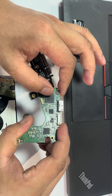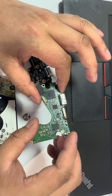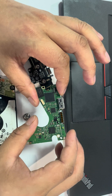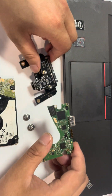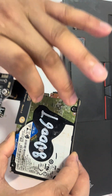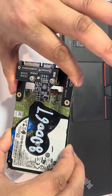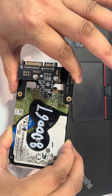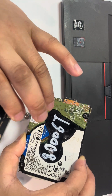In many SMR Western Digital hard drives, there is an encryption key stored on the MCU — the main controller chip. After users swap the PCB or convert the USB interface to SATA, they cannot see data directly because the data is encrypted. But if users install the SATA connector onto the original PCB, then they can bypass the data encryption via the SATA ports because the MCU, the main chip, is still there and unchanged.